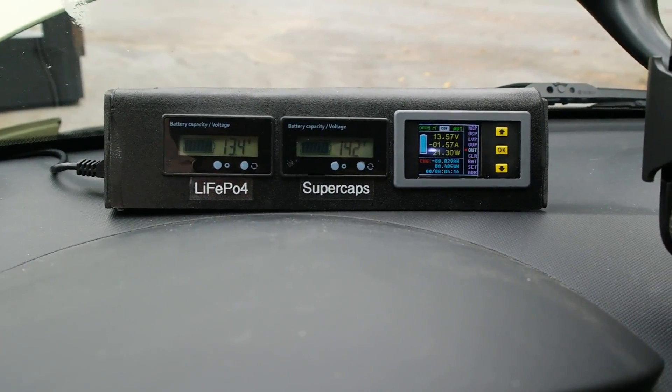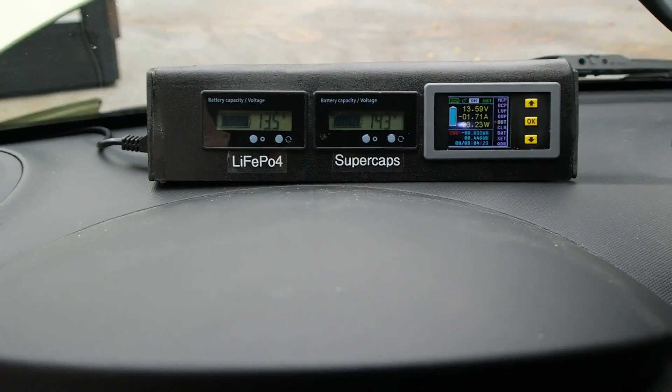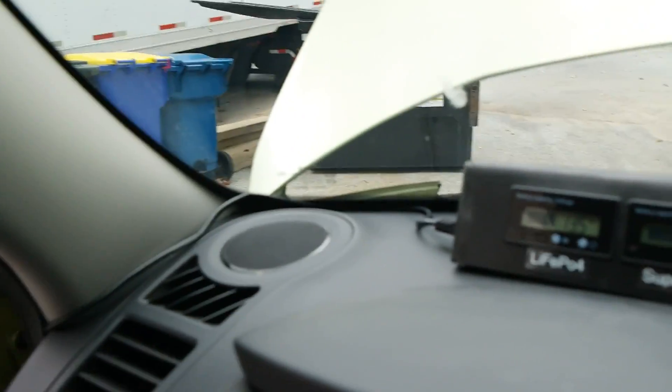The amount of super capacitors and the Farad capacity of my battery bank back there is overkill for this little two liter four cylinder car. I love it — it's just charging, happy as ever. It works, and it works phenomenally. We're not even dipping the voltage practically at all, and that's with the two gauge cable running from the trunk all the way up to the engine. It's not stuttering, it's not having a problem at all, it's not sluggish cranking over. And it's only 64 degrees today, so it's not really cold which would be a reason for being sluggish.